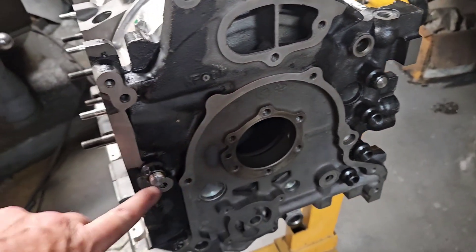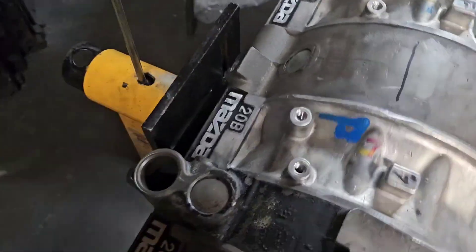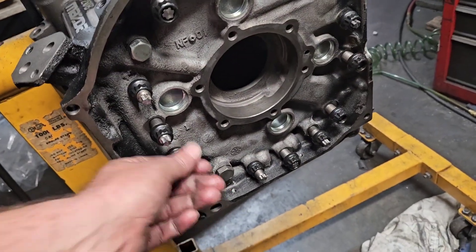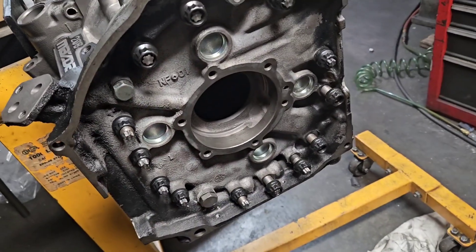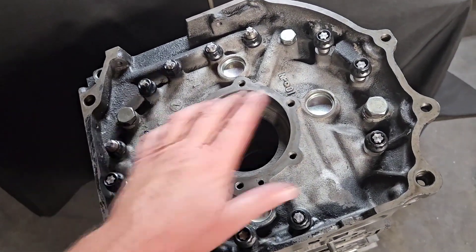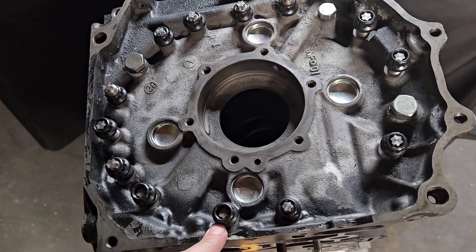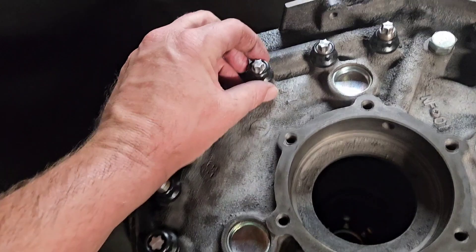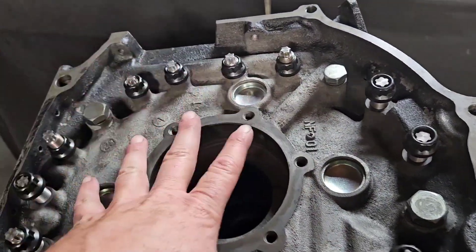You can see here are your main studs coming straight through. And then you still have the two OEM ones associated with your dowels that were already existing in the cast iron portions of the block. All of the ones that are not passed through are screwed directly into the front plate. With the block rotated, you can see you've got multiple studs running directly to the front plate where they're actually threaded in — tapping and remachining the front plate for precise fitment all the way down through the block. And then you've also got your straight-through studs, with nice precise fitment as well, that are basically tightened on both ends, clamping the block together.